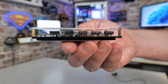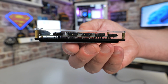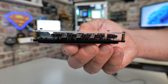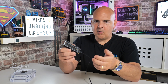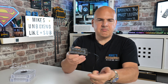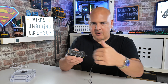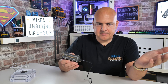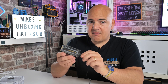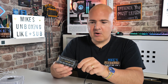I should clarify, because a lot of people ask this: the signal will only be replicated. So whatever signal is coming into this header, it will be exactly the same on every single one of those ports, whether or not something's plugged in. You don't get things like the chase effect — so if you want fans one to five to start at blue and go down the line, it doesn't work like that. All of them will be giving exactly the same signal at exactly the same time. There are also no fan connectors in terms of PWM or speed — this is purely for lighting only when it comes to fans, or if you're hooking up 5-volt addressable RGB strips.